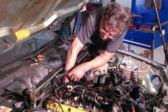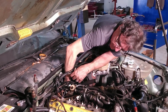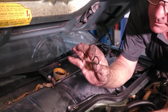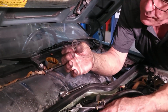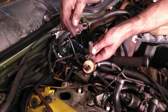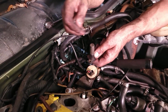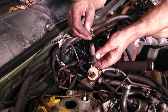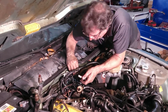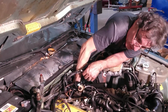The G one is right here, and they're moving, so that's good. There's the spacer. It's about 2 millimeters. Without this, it rubs on the ring gear and it shreds it while trying to start it. It will start and run until it breaks the wiring, and then it stops. But by then, it's already wound around the flywheel. Just keep that in mind. That was a bad day. Oh, that was on a turbo.